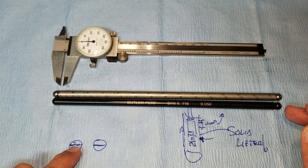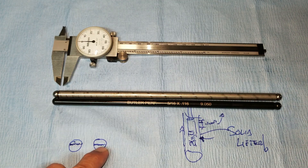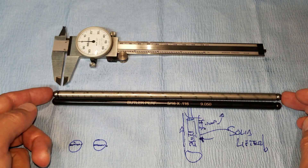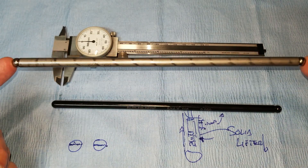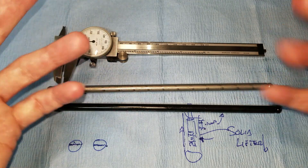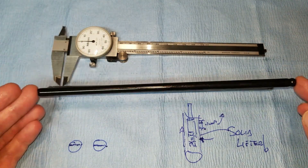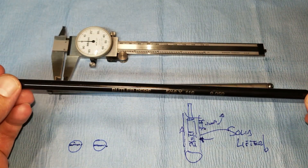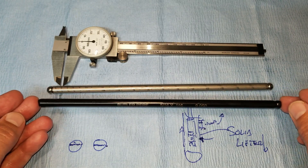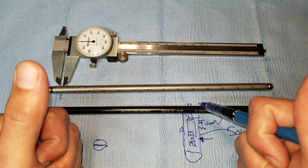So we're good — we're gonna use the Butler rods that are measuring a little too short, but when operating with oil pressure they're gonna come out to the right length. That is the theory with the 100 thou extra. I'm gonna go ahead and put these in the motor and then show you guys how to adjust valve lash correctly.